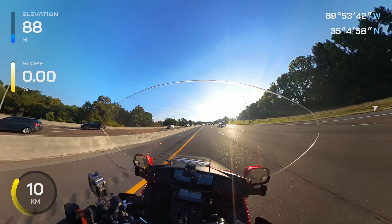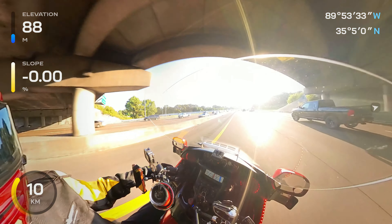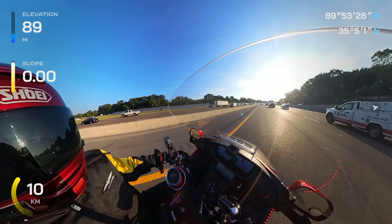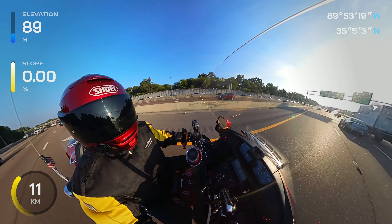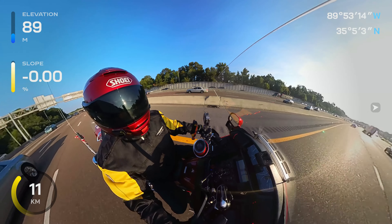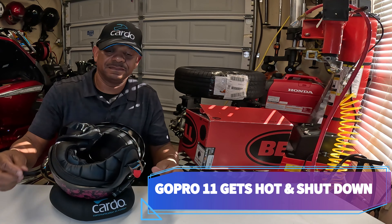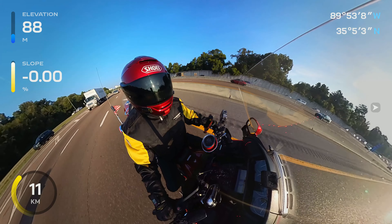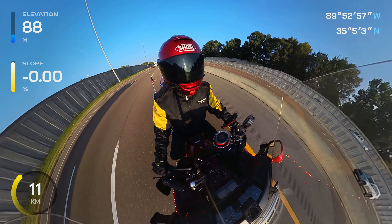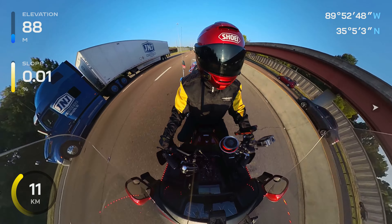And that's been a while ago. If you guys missed those videos and want to check them out, I'll include a link where you can watch my older GoPro issue videos. The problem I found with GoPro is that when you run those cameras in HD or high definition and increase the frame rates to get a good clear picture, the camera starts heating up on the outside. So they have heating issues — the batteries swell. You may have a regular battery and try to put it into the camera and now it won't fit, or if you get it in there, it's almost impossible to get the battery out because the battery swells up behind the overheating issues.